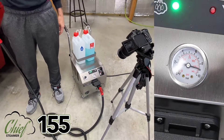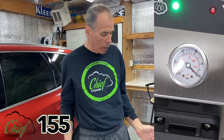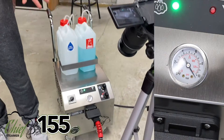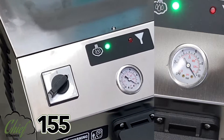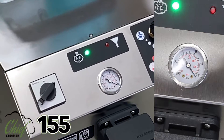Now I stopped it. You saw that the machine hung in there really well — it dropped to like 125 and held really good at about 120 to 125 as I was blowing steam at full blast. Then as soon as I clicked my finger off the trigger and started talking, it goes back the other way and we're back to recover. You can time this on the video — my calculation is it takes about 13 seconds to recover from 120 back to 155.